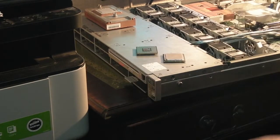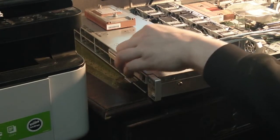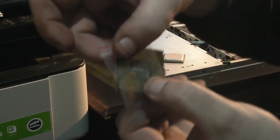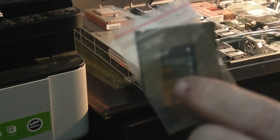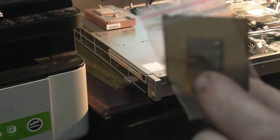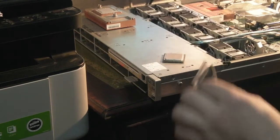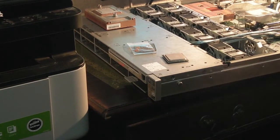And what that does is it actually sticks over, literally, sort of like that. It actually sticks in place over the bottom of the CPU in a specific place, and it swaps them two pins around, so the motherboard will actually work with that processor. So I think that's what we're going to do next.